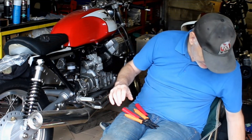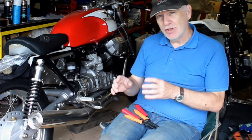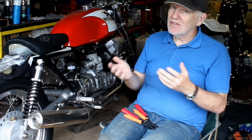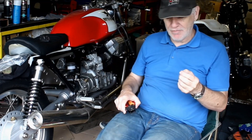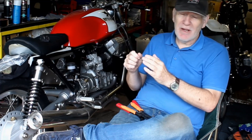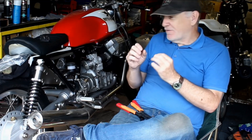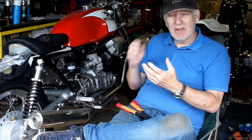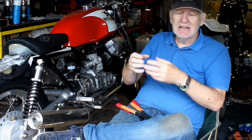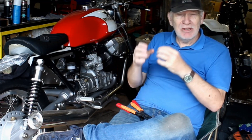When it comes to connectors in general, I've moved away from multi-pin connectors — the big white blocks you get on OE factory bikes where six or seven wires go into the same connector. The reason I don't like them is packaging: the blocks are quite big and unwieldy, and they're hard, so if you zip-tie one close to your frame or bodywork it will wear down your paintwork. On a custom bike you also don't have the special brackets to hold them in place.